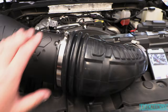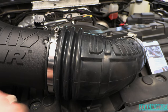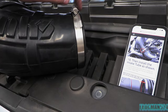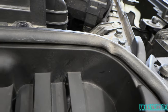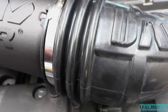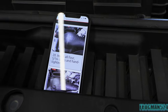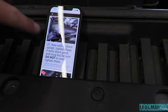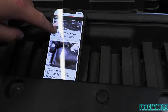We've got the 88 clamp on here just a little bit snug so it stays on. There's a notch, so you want to line this elbow up with the hat — when you force it on there it'll actually click and snap into place, then make sure it's even all the way around before you tighten this up. Same thing on the turbo side — the 72 clamp is just on there enough so it doesn't fall off when we install it on the turbo mouthpiece. The groove matches up and it'll click in. Now we're going to place the lid over the air box and insert the four 5/16 stainless bolts — just hand tighten, then use a 10mm socket to tighten those up, and then get the band clamp installed on the turbo side.